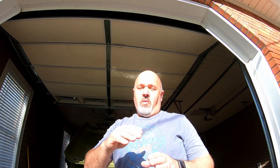Guys, I know when I got back to building on the engine, the last part of the video I just kind of went through fast. I didn't want this video series to go on and on and on. And I showed the things that I thought were important. The one thing that I didn't show that I maybe should have was the rocker arms, but that's kind of self-explanatory too. It's not rocket science. I did use a dial indicator to check my pushrod to lifter preload. Everything was good. And so anyway, that's going to wrap up this video.